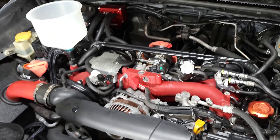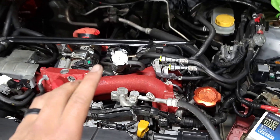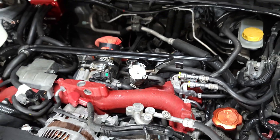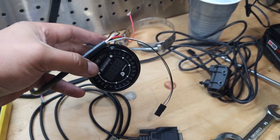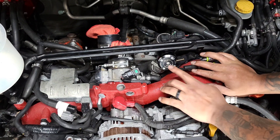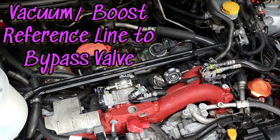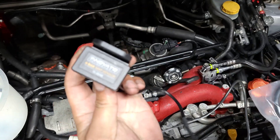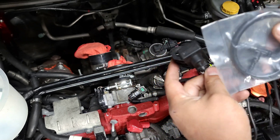Alright, since I have all the charge pipes off and I have some space right here, I'm actually going to split this and tee that into the boost gauge sitting right here. Get that all squared away and push that through the firewall, tee off of this line that goes to the blow-off valve. The MAP sensor — I'm going to be leaving it out in the engine bay. This is the Innovate 4-bar MAP sensor; I'll leave it right in the engine bay and have this line hooked up to it.